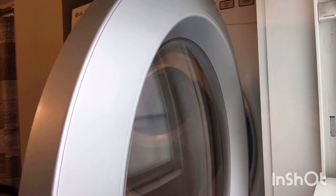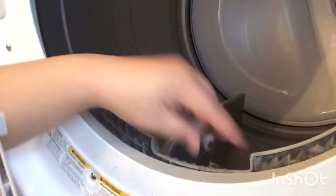One more thing I want to show you — this is where all the dirt and dust from the clothes collects. There is a screen here like this. Be sure that you remove and clean this. Sometimes it can cause a fire in the house if these things build up, so we need to clean it. After every wash you should be cleaning this. The person who used it before maybe did not clean it, so I'm going to clean it first before I put my clothes in.